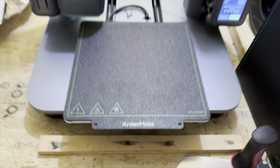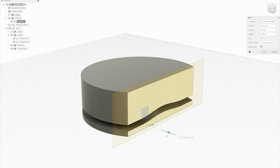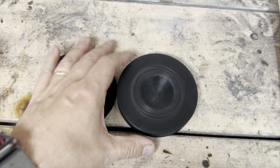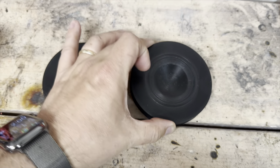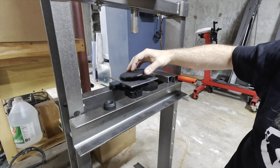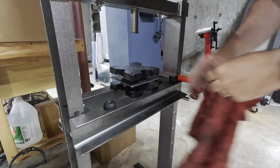Let's try that again. Instead of using washers, I decided I could make my steel plate bow upward to match the top of the shock tower. Luckily, I have a press and a 3D printer. I designed some simple dies and printed them with 100% infill, which means they're basically solid blocks of plastic. The idea is to press a dome into the plate that's big enough to fit the bushing and allow enough of the stem to extend above the tower to get the nut on. I made the dies to account for the thickness of plate, so once fully pressed, the plate should exactly conform to the die.